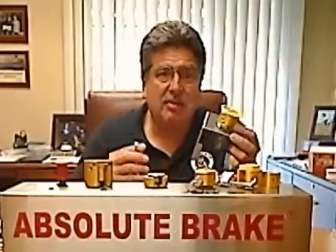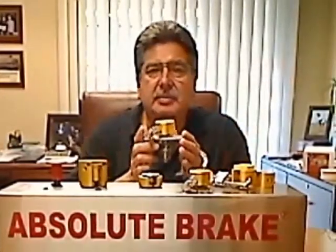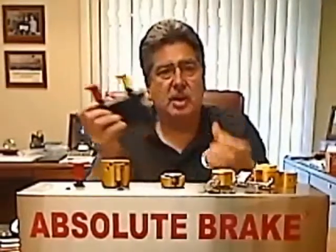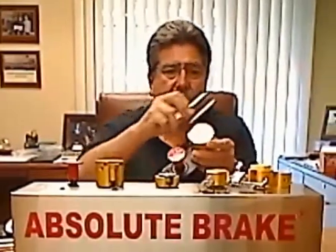For the mechanic who's underneath the vehicle, he normally would want to put a padlock through and secure the device. So now it's a lockout, tagout securing device. Mechanics love this product because when this is on, they can move around freely, get underneath, and do whatever. We've actually had mechanics get run over by a vehicle, and recently we had one individual killed when the vehicle rolled over him. So we want to really avoid that. That's why we emphasize the lockout, tagout on this. Same thing with the commercial design: swivel on, swivel off. Once it's on, you put the padlock through, and now it's a theft deterrent and lockout, tagout.